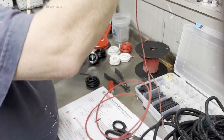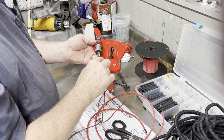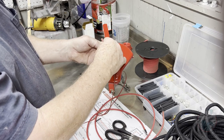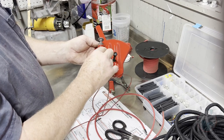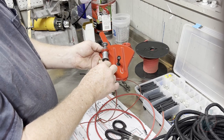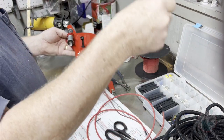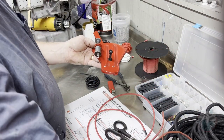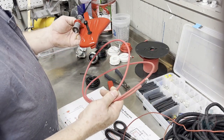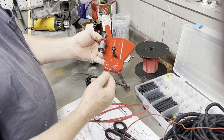So I have the old wire here, which measured out to 60 inches. This connects onto the bottom of this switch, and when you push this down, I think when it goes down, it grounds it. I can't remember if it's up or down, but I think it must be down because down is grounded. So when you ground it, the magneto won't work. So this is not carrying any current, so this can easily be a 14 gauge wire. In my case, I have this 10 gauge wire that has a really nice cloth wrapped red piece on it. And this is a standalone wire, not in a loom that you see.